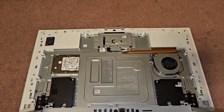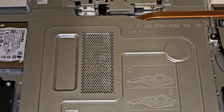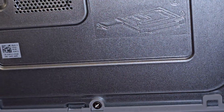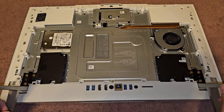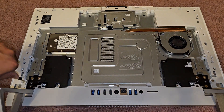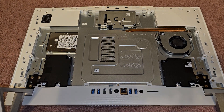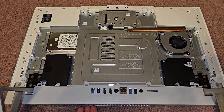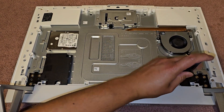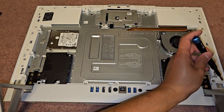They have little pictures here to show you. It looks like there are four screws holding this down, and we're very likely going to have to remove the plastic bottom cover here first. So let's go ahead and remove these screws. We got one here, another one here — two, third one over here. I was pulling up the clips from the bottom before and it was kind of popping up, but because these screws were holding it, it didn't come out all the way. So four... let me move these screws further away — I don't want to accidentally put the screen on top of them. Four, and one more here. Five.